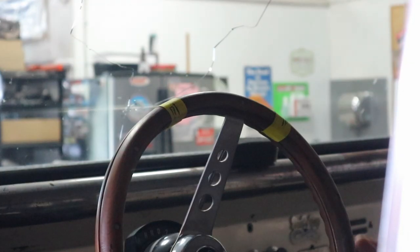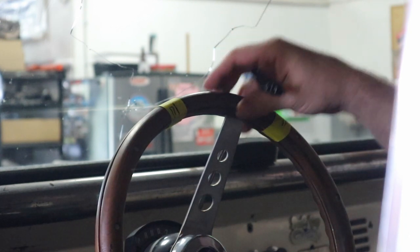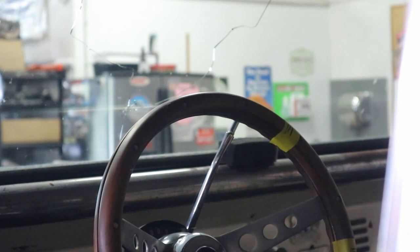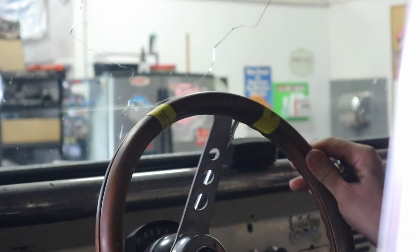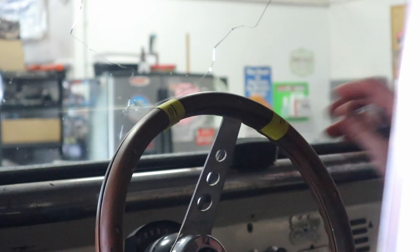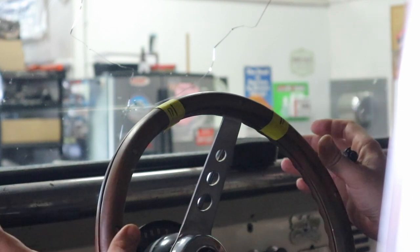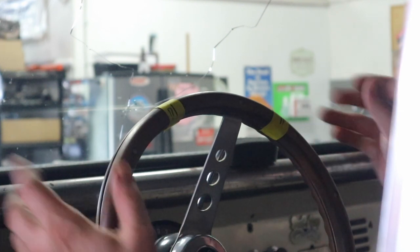As you can see, the steering wheel is not centered with the box. This is a great time to go ahead and pull the steering wheel off and clock it so it's completely center. In this case, where you have a three-spoke wheel with the Ford logo, you're going to want it sitting right here. Make sure you've got your steering wheel centered with your box first, then without moving the column, take your wheel off, turn it, and re-bolt it — reattach it to the splines so it's perfectly centered with your box. And that's how you get your steering wheel, your box, your pitman arm, everything straight and perfectly dialed in with your Bronco.